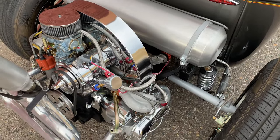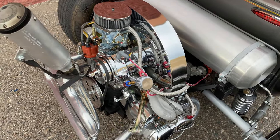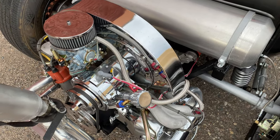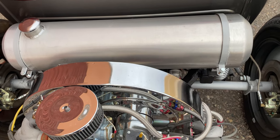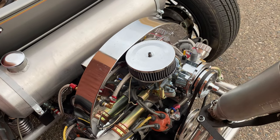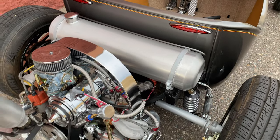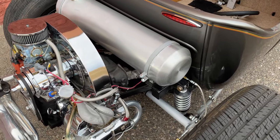The three-wheeled Polaris autocycle from 2015 to 2019 utilized the 2.4-liter Chevy Ecotec with about 175 horsepower — you can pick those up for about $900 to $1,000, plus about $400 for your wiring harness, and run a radiator for about $100 from eBay. If you want to go with a Subaru EJ20 or EJ25 out of a Legacy, those things are pumping out 275-300 horsepower turbos in a car that weighs a thousand pounds — you'd be doing wheelies all day long. You can pick up EJ20s and EJ25s for $1,200-1,300 with a wiring harness — they're wicked motors.